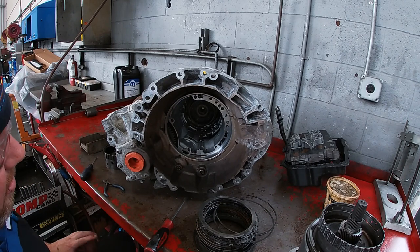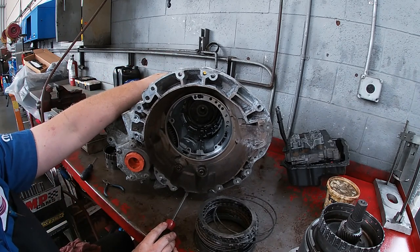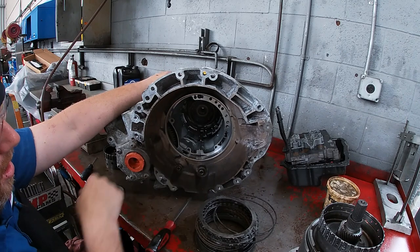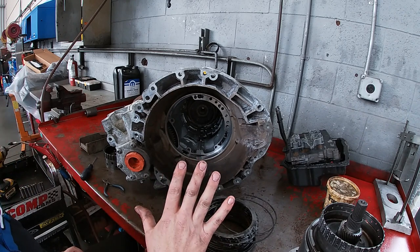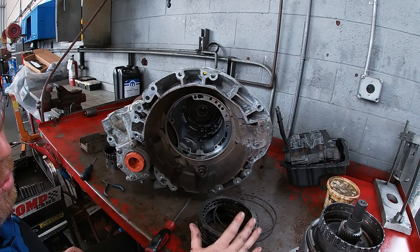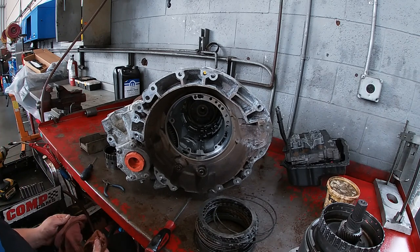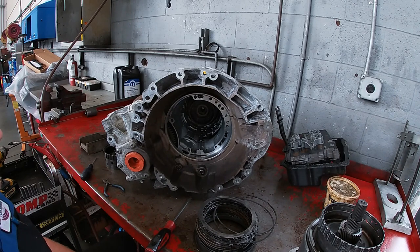We're going to leave this video here. The next step would be to spin the trans around and take the side case off, remove the transfer gears and the top transfer gear to get the last planet carrier out, which would give us access to the low reverse piston. As it looks, these don't appear to be burnt from a hydraulic issue — they look like they're just worn from normal use. This did come out of a cargo van, so it did see some use. In the next video we'll start to reassemble and go into the compounder assembly and continue on with our overhaul of this 62TE transmission. Thank you for watching and we'll see you in the next one.